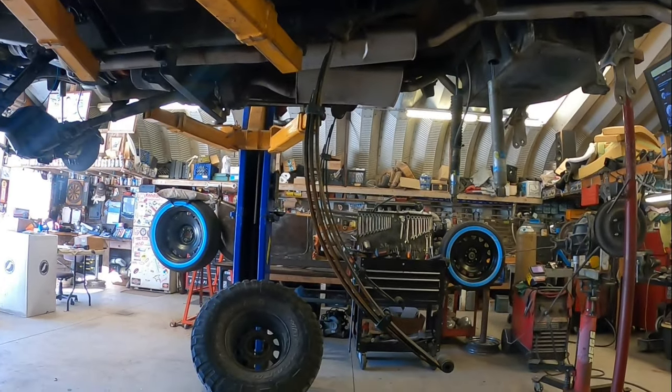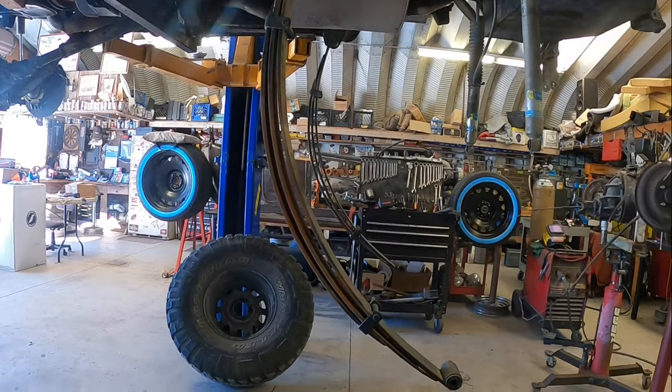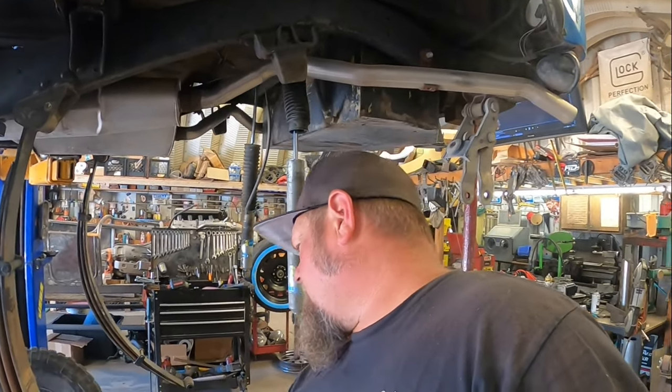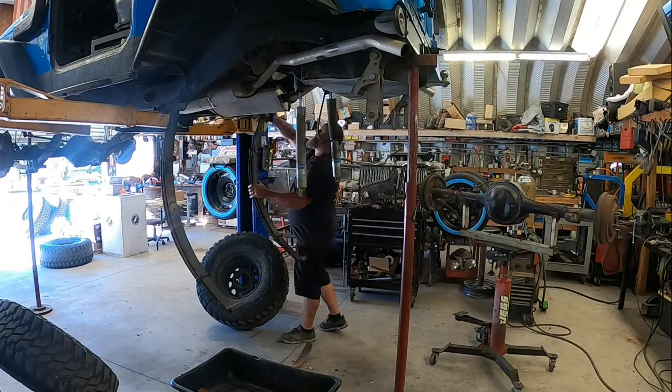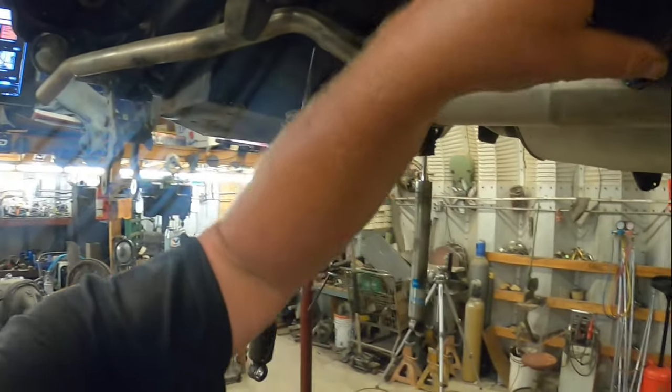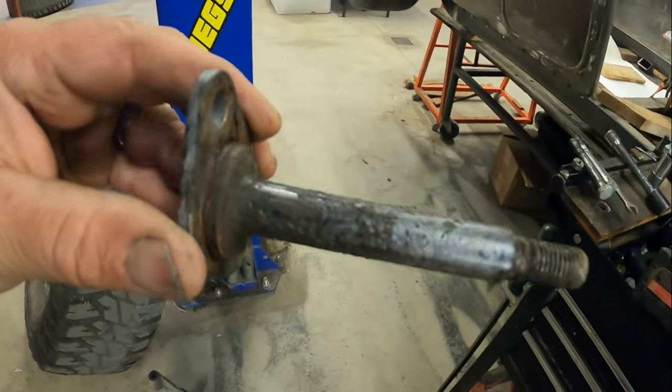Hopefully the springs aren't bent - just by looking at them they're obviously not. I'm gonna measure from center of pin to center of pin, make sure they're even in the right direction. Hey, these have numbers on them - I didn't see the numbers. I'll have to see what brand these are. Got the rear end pulled, leaf springs down, gonna have to go through and recenter them, clean them all up. Got the front pivots out - they are beat to heck. So I ordered a brand new pair of Old Man Emu pins, kind of like what the front has. Somebody's already done greasable pins on the front and these should save some bushings.